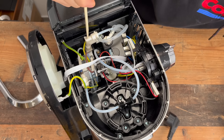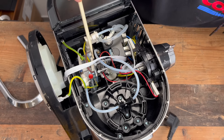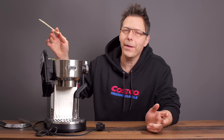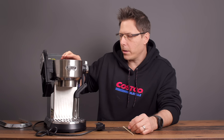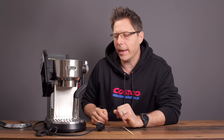So the surprises are interesting: we've got a different overpressure valve, a thermal probe indicating a PID, two solenoid valves, and finally with this Maestro Plus we've also got a water tank monitored for water level — so when the water level is too low it won't pull a shot. That is a very nice feature.